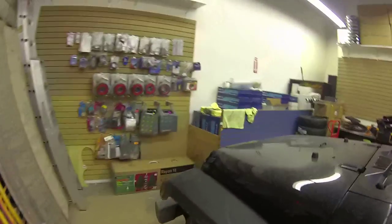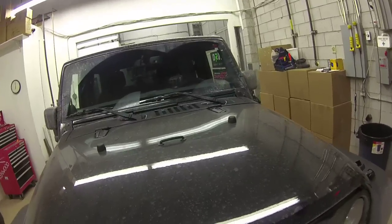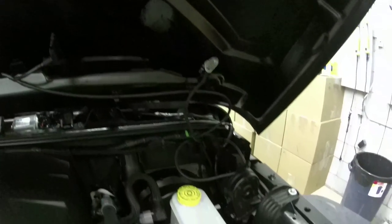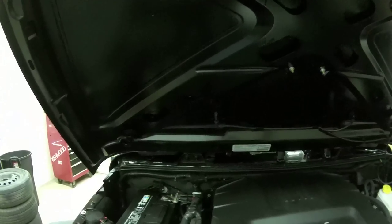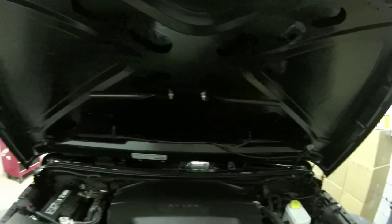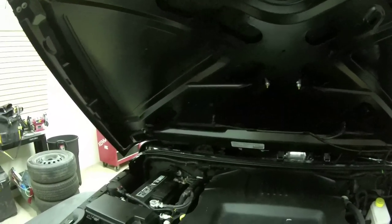I'm going to briefly show you one other thing which is important on this particular vehicle. As you can see, it is very easy to open the hood on a Jeep — in fact a little bit too easy. So rather than a mechanical hood pin switch, we installed a mercury pin switch that detects tilt. There's a ball of mercury inside that switch; when the hood goes up the mercury goes to the back, completes the contact, and triggers the alarm. There's a siren at the back, and wiring is all loomed and run through factory grommets. On this vehicle we did have to run a power feed from the battery, as we feel more comfortable going direct to the battery for feeds that handle more than 10 amps. We've used a special type of tape called Tessa tape and zip tied the harness up — it's very hard to see that it is the main power feed for the system. It wouldn't matter if a thief got to that anyway, because by the time you open the hood the alarm would go off and we've got a battery backup system equipped on this Jeep.